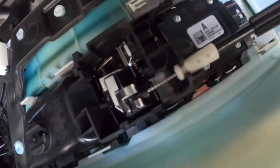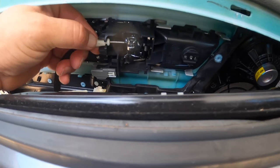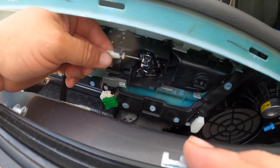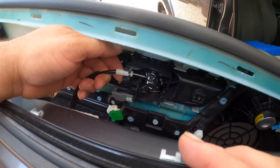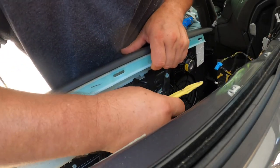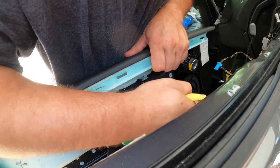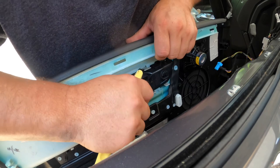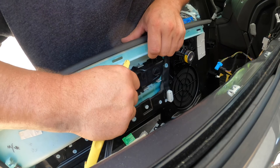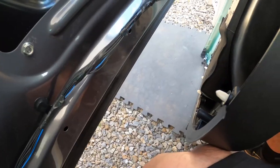There's a connector right here to remove the door handle. This little white piece — the connector is supposed to snap out of there. My concern is that if I'm too aggressive I'd break it and have to buy a new one, but that is the way to get it off. Pop that — then you have to rotate the cable out, then lift up and out.